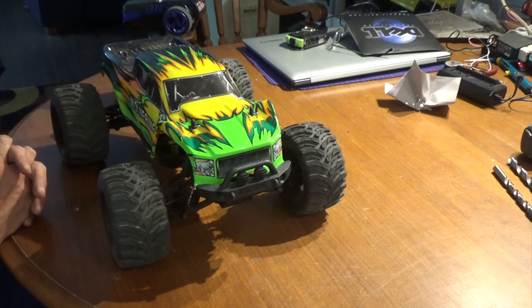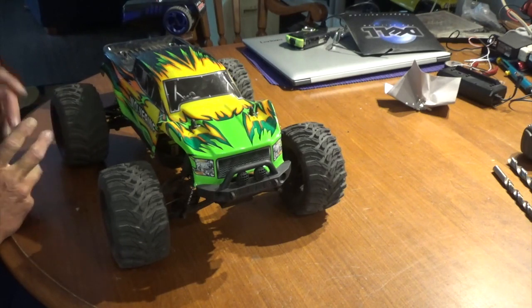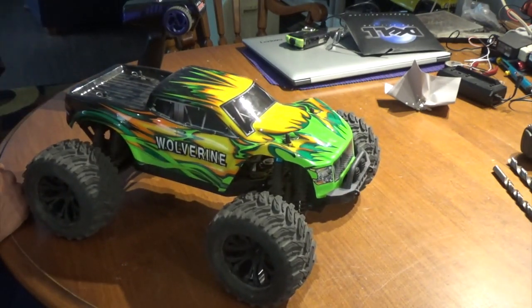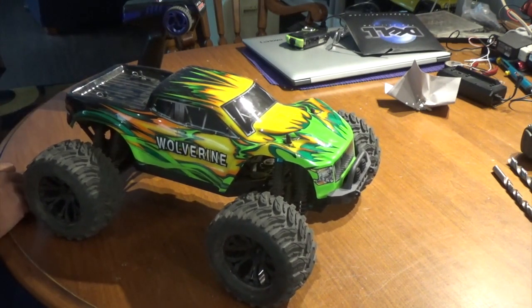The rest of the truck is totally awesome and definitely worth the money as an RTR with a LiPo included. You easily get over 20 minutes of run time on 2S, which is great. I've also bought higher-discharge 6300mAh 2S extras. You can run 3S, but I think you'll start ripping apart dog bones — these are CV dog bones, dogged at one end and CV at the other, so I'd advise staying on 2S at least until you gear it down.